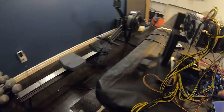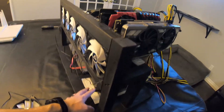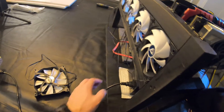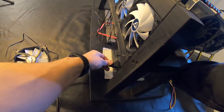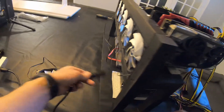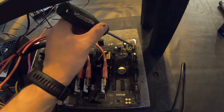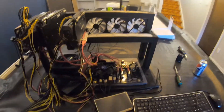We've powered down the rig and left the power switch on. Before you work on a power supply, you need to discharge all the capacitors and that type of stuff. At the same time you still want to be safe and not just touch anything inside. What you do is unplug the power supply from the wall and then try to start the computer a couple of times. Good — so now we're at least semi safe to start opening this power supply and working on it.